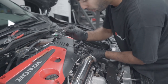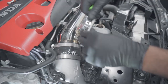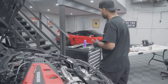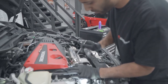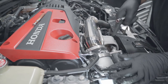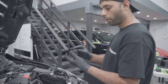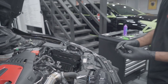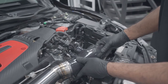Here's a little bit of the tricky part — we're going to use that OEM bolt, slide it just in behind. Make sure all these bolts are nice and tight on the inlet. These are your two coolant pipes. What I like to do is use an extension and just slightly push this away so it has a nice radius for the coolant pipe — not touching anything, free from anything. In the kit you're provided a billet aluminum piece for your sensor on the top. This allows it to be adapted to the intake tube — it goes right in like that.